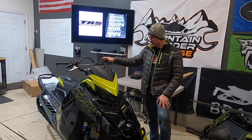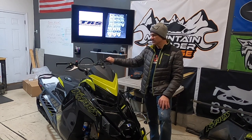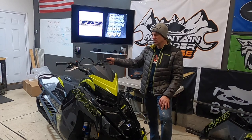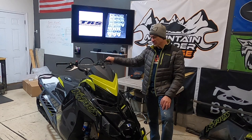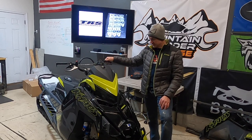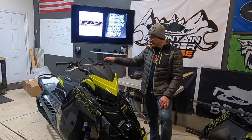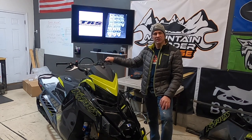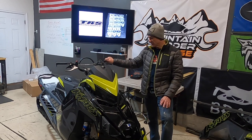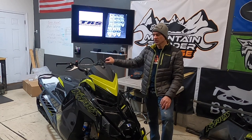We've been out twice and ridden this sled on two different occasions since putting the motor mounts in and getting all our clutches aligned. It's a noticeable difference. I gained about 150 to 200 RPM on the top end, and the engagement throughout the clutch process is just a little smoother as it shifts through on and off the throttle. The belt heat when you come down from a big climb is noticeably reduced — the clutches weren't near as hot as they were before. Really good product. This is for the guy who wants perfection out of his clutches. If you're going to put a clutch kit in your sled, it's really good to set all your alignment parameters first, because no clutch kit is going to work as well as it should if your alignment parameters aren't set correctly.